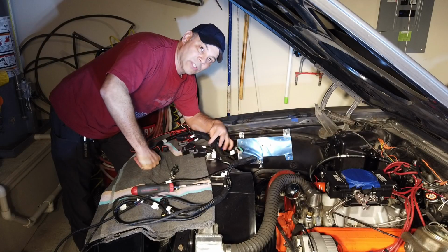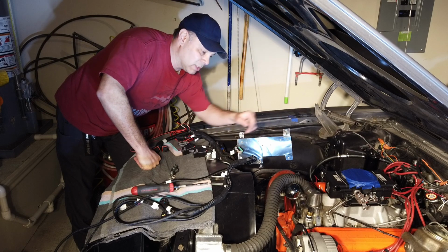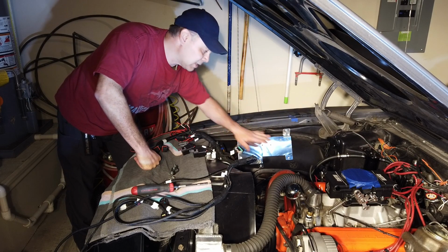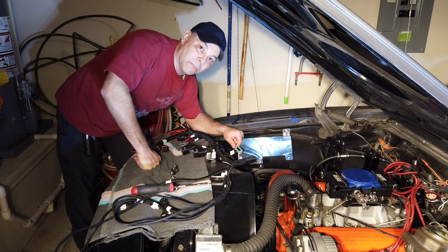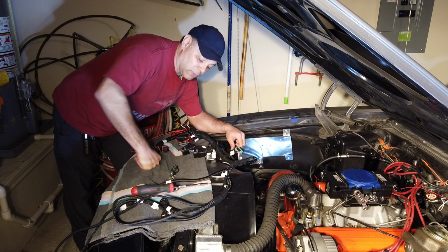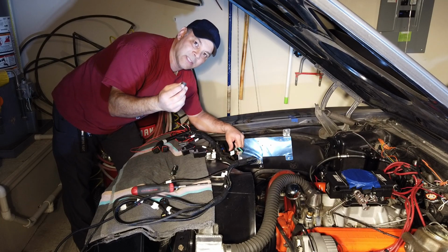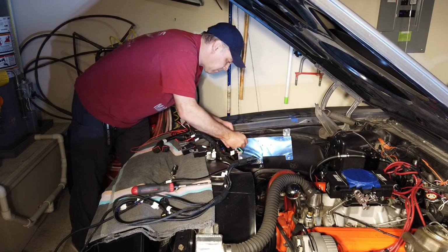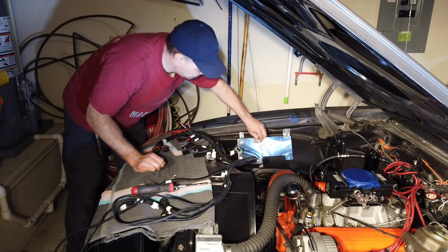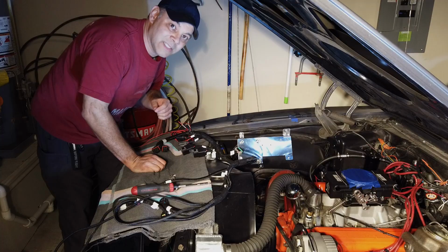Right on. So I stretched out the wire harness, and this is going to be a trial fit when it comes to the back of the engine compartment, because I'm not going to mount it permanently at the moment. I just want to get my electronics onto my mounting bracket, and after that I'll figure out what my routing is going to be. So first thing I'm going to start off with is these rubber isolators that come with the ACES EFI kit. Just spin them on. There we go. Now, the ECU.